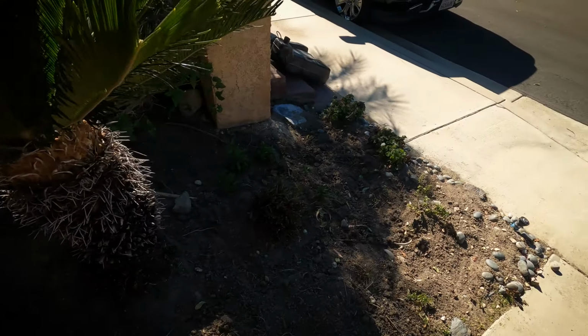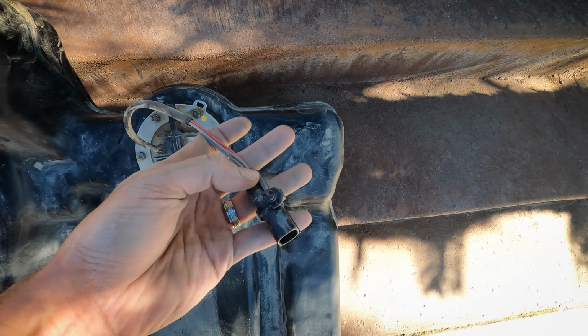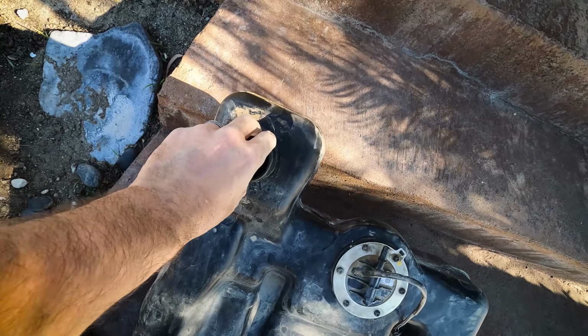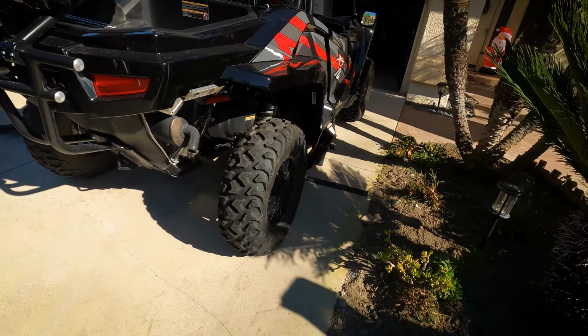But now, as you can see, it's easy to get to the bolt here, and now it'll be easy to get to the bolt there. Let me show you the fuel tank here. So it just makes it easier. You unclip, and then this little clip you can reach from the back to push it out, and then our connection point right here, and you pull off the filler neck, the goose neck, with the C-clamp there. So get this other one out and get them all back in.